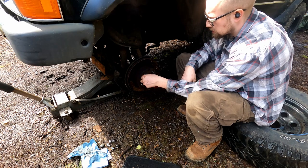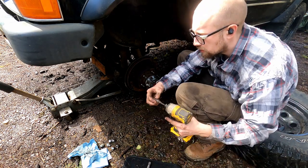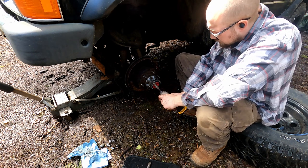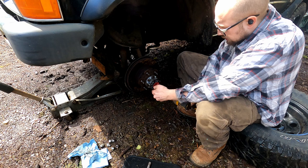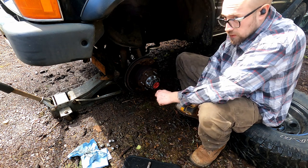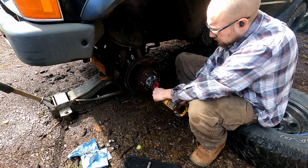There are proper tools for checking bearing preload, but I've never used them — on daily drivers and wheelers it's all about feel. Take a 10 millimeter and take these locking hub bolts off. If they're super rusty I might recommend against it — these little 10 mils are easy to break on Toyotas.